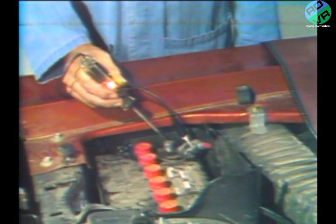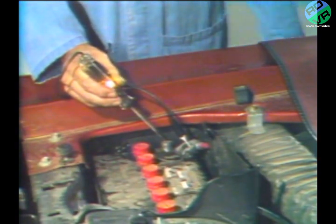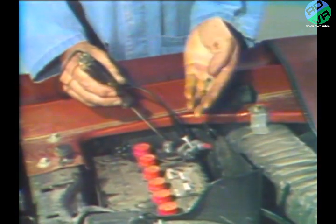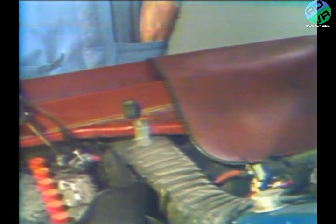Should a condition of battery drain be noted by the test light, first try to stop the current flow by removing one fuse at a time. If you pull a fuse and the drain stops, you know you have trouble in the circuit that is protected by that fuse. If removal of all fuses doesn't stop the battery drain, disconnect the harnesses at the quick disconnects. Disconnect one harness at a time until the drain stops. Then trace down the cause of the drain in the circuit or circuits supplied by that harness.